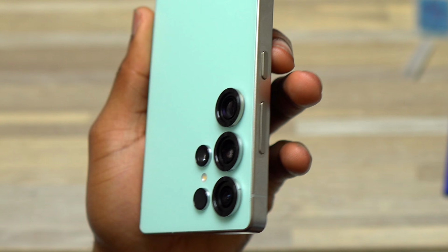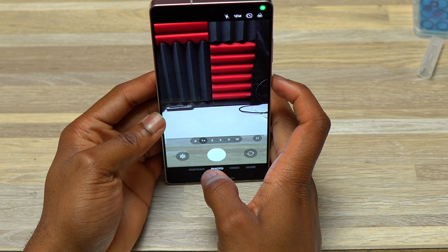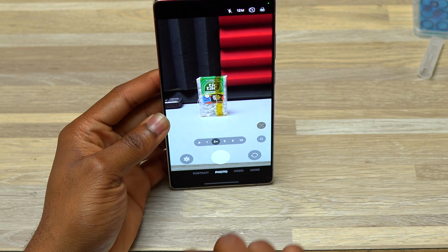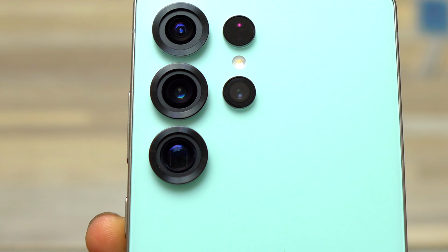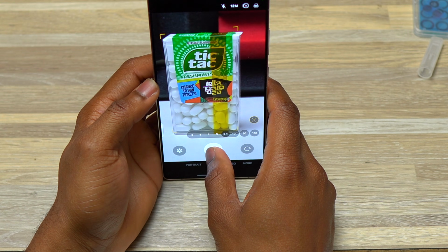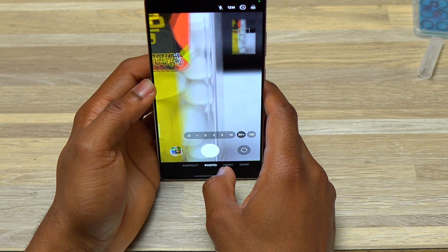All the broken camera glasses have been removed. The next step is to test the cameras just like this and make sure that everything is in focus, everything is working like it was previously. You can also do a visual inspection of the camera modules to make sure that none of them have scratches and they are pretty clean. They do not have dirt or debris on the camera modules.